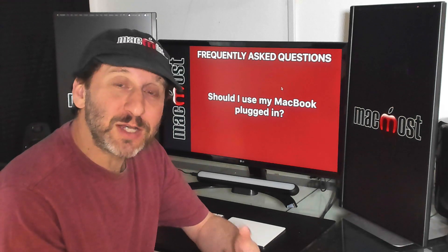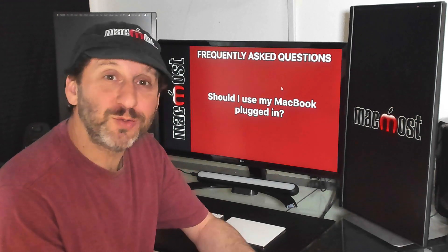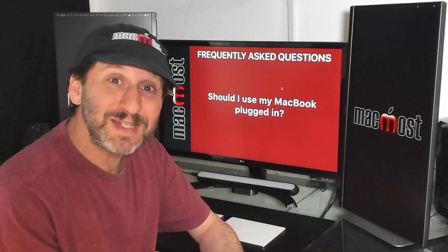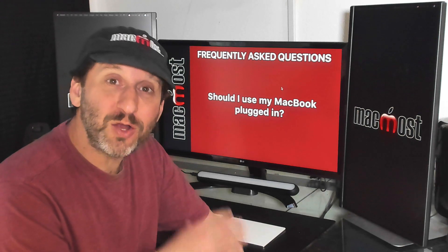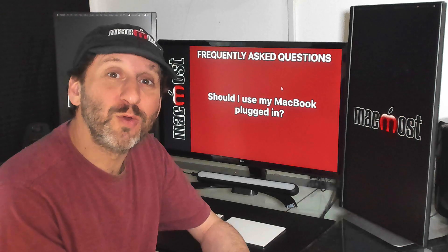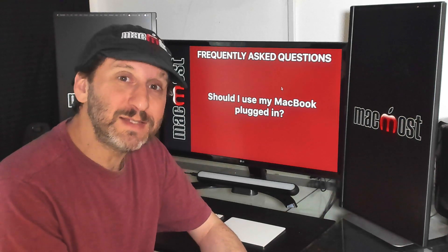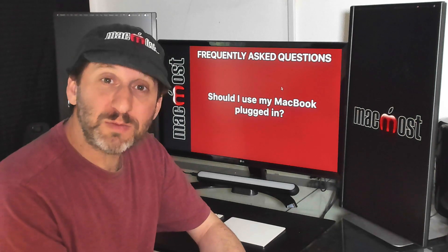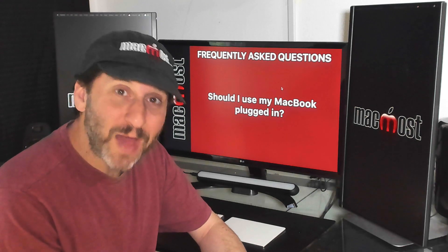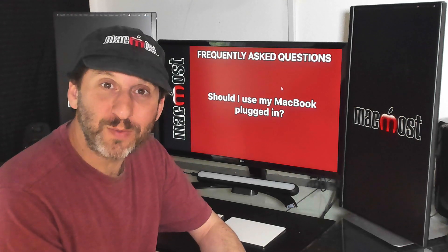There are a lot of myths out there with bad information about how to use your MacBook's battery. A lot of this dates back to before the current generation of batteries, for older laptops, and it's just been repeated over and over by bloggers and news sites. One of those things is: should you use your MacBook plugged in? The answer is yes — it's all about cycle count. If your MacBook is sitting on your desk, have it plugged in; don't use the battery and you won't go through those cycles. It's perfectly okay to have your MacBook sitting on your desk charged up to 100%, and you won't damage your battery by having it plugged in for a long period of time.